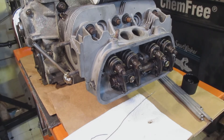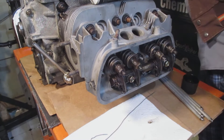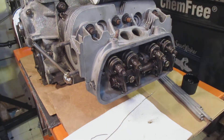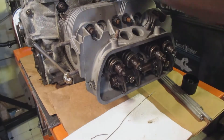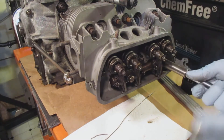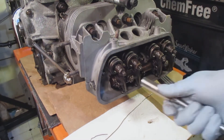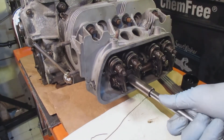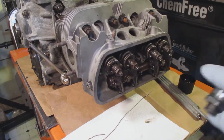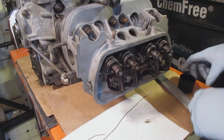Sometimes you're not able to put the washer on right away, so I sometimes have to tighten up one of the nuts to get the rocker arms up to the head so I can actually put the rocker arm nuts on and tighten them up. I like to use lock washers on these two 13mm nuts — I've had it in the past where those nuts come off and it's not a good thing for your engine.